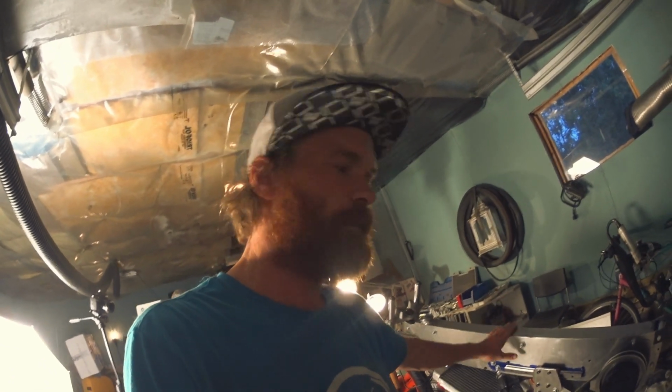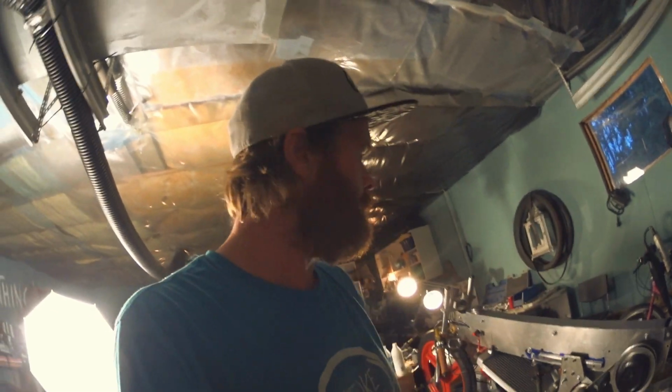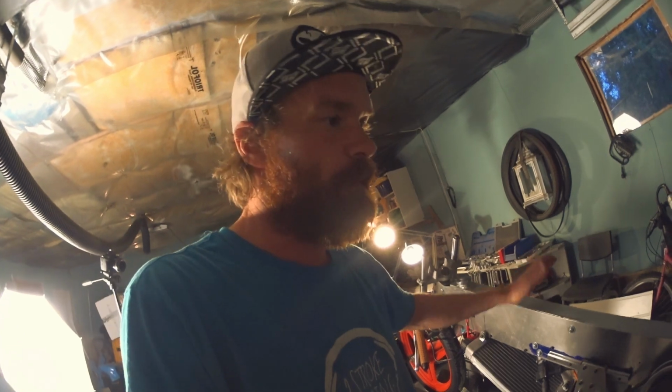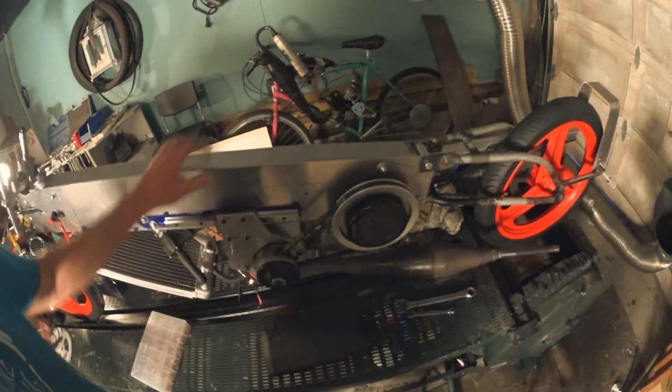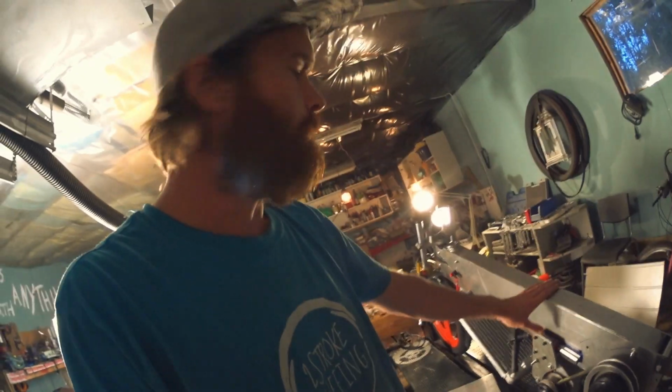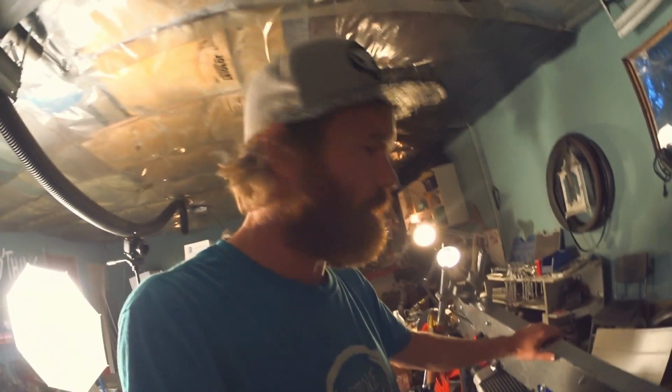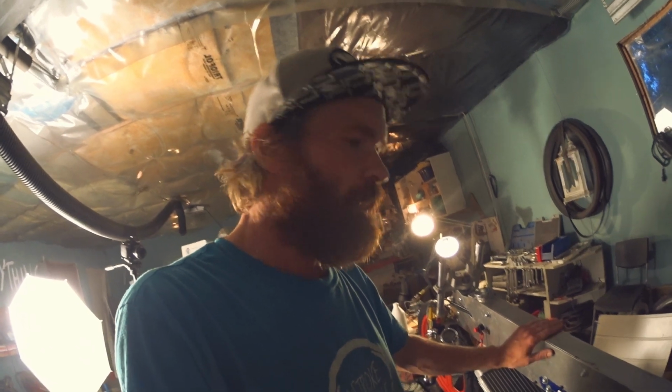Issues: the tank is still leaking. I haven't used the tank sealer yet, so I will take it off and seal it with epoxy. That is probably a good idea anyway, because there's some vibration. The engine is stiff mounted to the frame and it's aluminium and prone to cracking from vibration, so an elastic epoxy liner is a good idea.